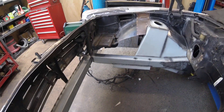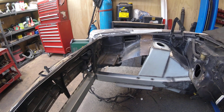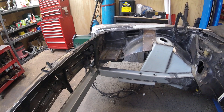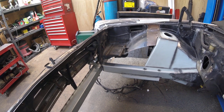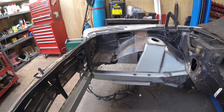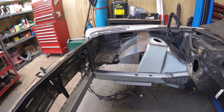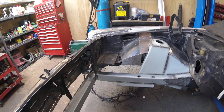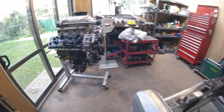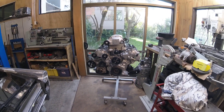What's basically left on this side is where the battery box is. Anyone who's had anything to do with cars will know that lead acid batteries tend to leak and that causes rust. That's what all the issues were with the front of the chassis rail and that cross member earlier — all to do with rust from the battery area. I'll have to chop quite a lot of that out to make a nice job of it so we don't have issues going forward. Don't want it rusting out later down the track.